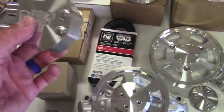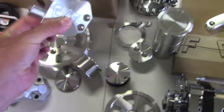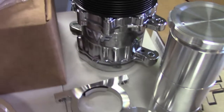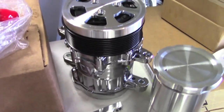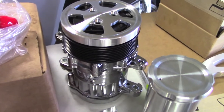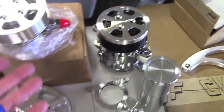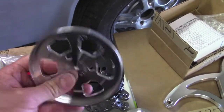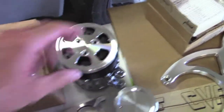This is a really nice piece — this is what's commonly known as the landing pad. It goes on your AC compressor, where you put your high and low pressure lines. The compressor is peanut style chrome. It's a shorty so it doesn't stick out too far off the front of the engine block, which allows you to still run a mechanical fan if you so desired. Of course, electric fans usually leave plenty of room. And just a compressor clutch cover — I like that.